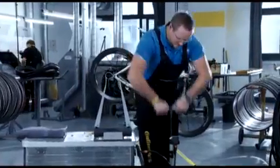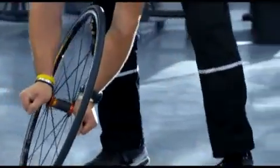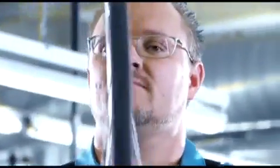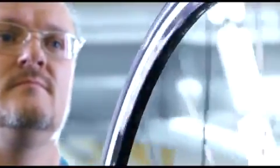Now put the wheel back in the truing stand and allow it to rotate. Check it once again and make fine adjustments. If the tire has no lateral runout, remove the wheel from the stand and inflate tire fully. Apply load to the wheel using the axle journal and the quick clamp and roll it along the floor for several meters. The wheel should be vertical as well as tilted to the side for several rotations. Then check that it indeed runs true and has no radial runout.